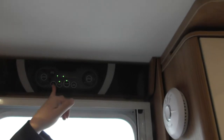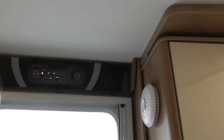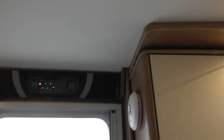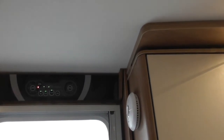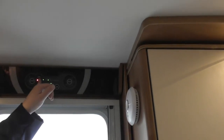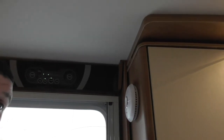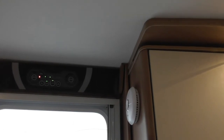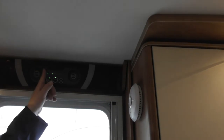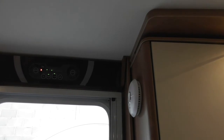We've then got your tank fill on the very end. All you need to do is go outside, unplug from the bottom inlet, plug it into the top one, come inside and press tank fill — and it will fill the tank. That powers up the external pump and draws water from the aquaroll into your internal tank. Just keep an eye on the level up here. When you've finished, switch it off — it will run constantly, and it won't flood the van because there's an overflow, but the pump will keep running, so just keep an eye on it or listen out for it.